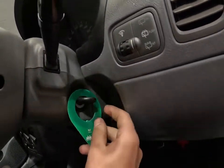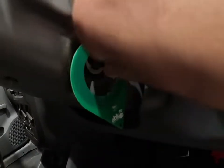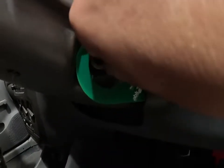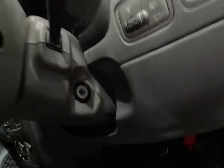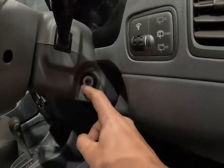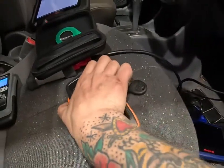This will make sure that our key coil is functioning. When I turn that on, you should see it flash. That means the coil is not open circuit. It does not mean that the key is good or the wiring is good, but it does mean the coil is functioning. So at this stage we're not worried about an issue with the key coil — moving on from that test.